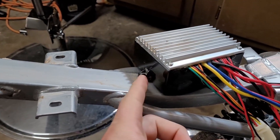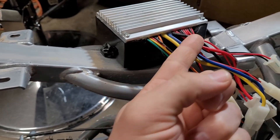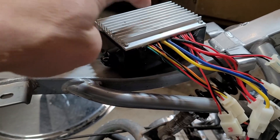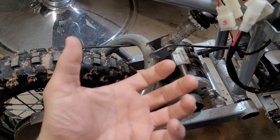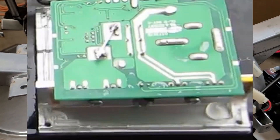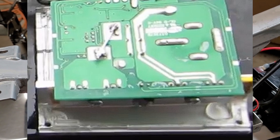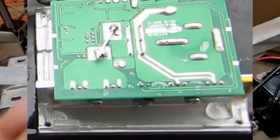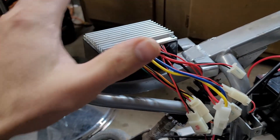What I did is I ran a razor blade on the top of this to break that seal, and on the bottom to break the seal down there. Then this whole top section comes off and brings the controller with it. This plastic piece is just left alone, but all of this wiring is connected to this piece here. You take this whole section off, flip it upside down. I'll have a picture of what that looks like, and then I soldered a connection between two of the pads, put it back together, and it still works.